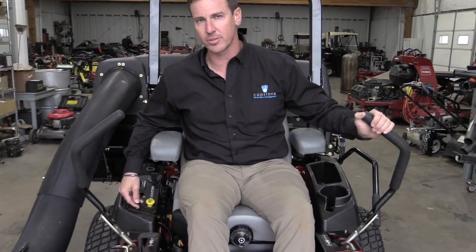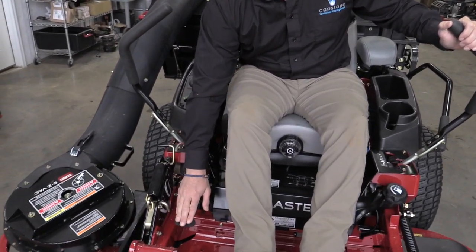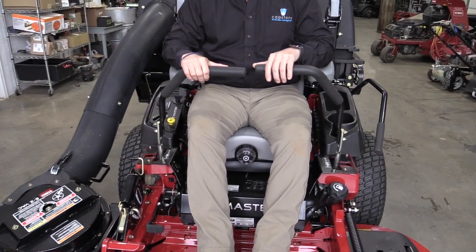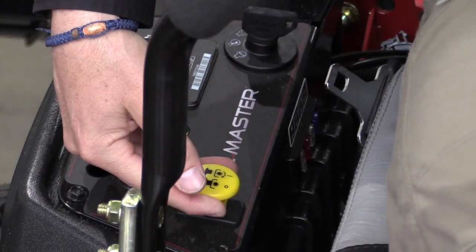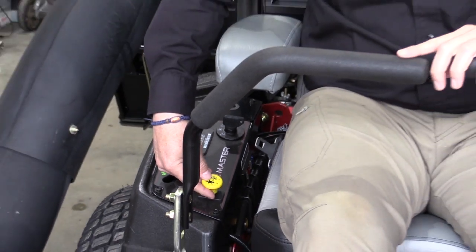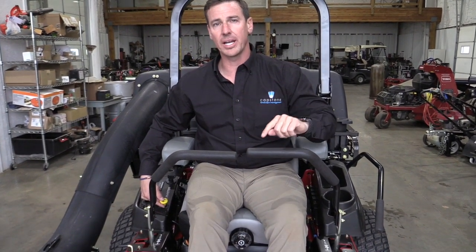After the lawnmower has been cranked, you do not have to pull the choke, and you're ready to engage the mower. Turn it on, release your parking brake, engage your hydraulic arms with your deck height set properly. Pull up to the lawn, then pull the PTO switch — the yellow button in the control panel. When you pull that up, you'll hear a click and the blades will engage. When the blades are spinning and active, make sure there are no people, animals, or debris in the lawn.